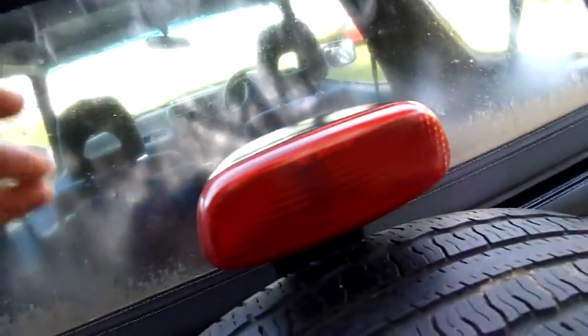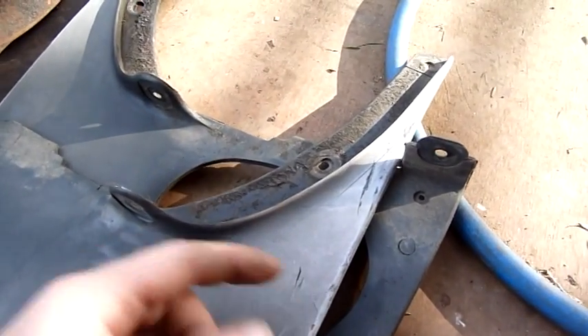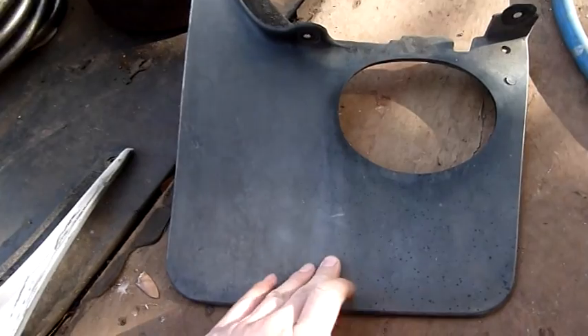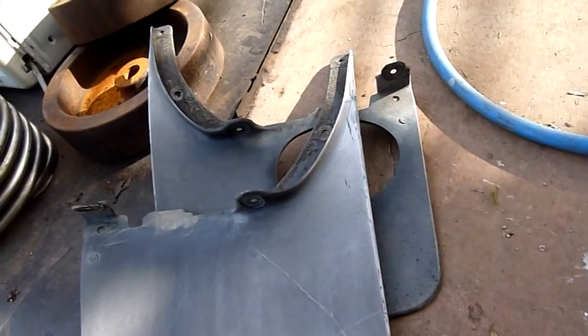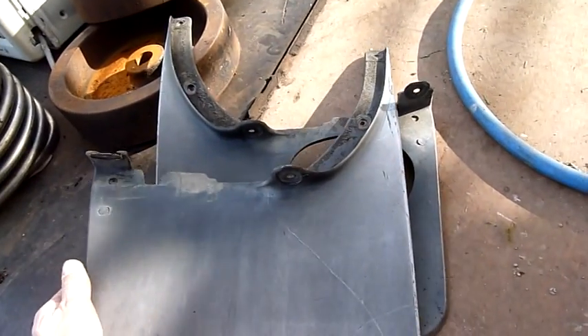The plastic conditioner works well — this has come up nicely, including the center rear brake light. I've got the mud flaps off because they're badly oxidized and chalky — it's a chalky polypropylene residue on them. I'll give them a good cleanup and try a few different restoration techniques, or if not I'll get the spray can of polypropylene conditioner.